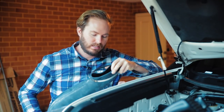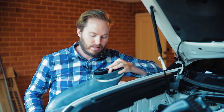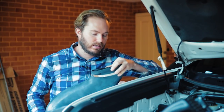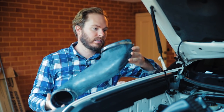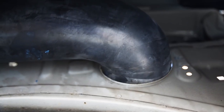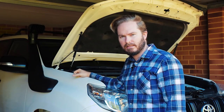Turns out I'm a bit rusty — you put silicone sealant in there. You want it to be airtight and watertight. So a bit of the same stuff we've used to seal up the holes in the airbox and the holes in that A-pillar up there — smear it around in here and around in there. Got our hose clamp on. This next bit can be a bit of a battle sometimes, just trying to get it over the end of the snorkel. New day, same finale — I'm going to finish this thing off. We got the pipe that goes between here and the airbox in — it's all in, it's got the silicone around it. A little bit messy, silicone everywhere, hose clamps around them, but it looks watertight.